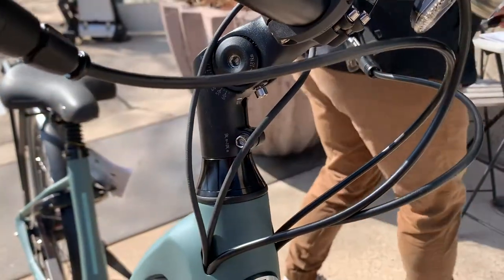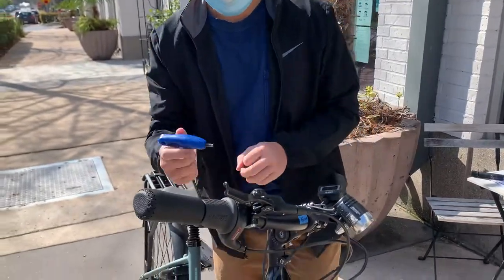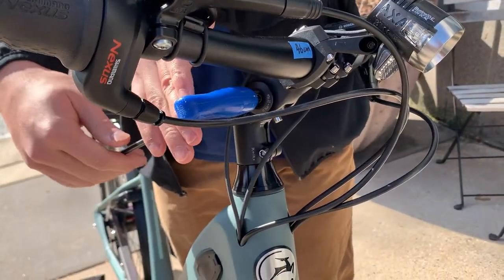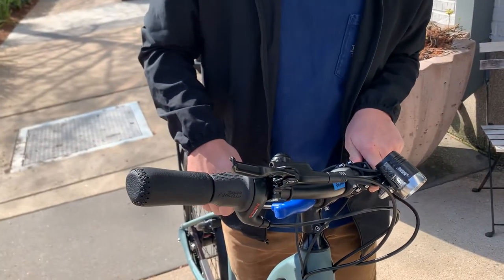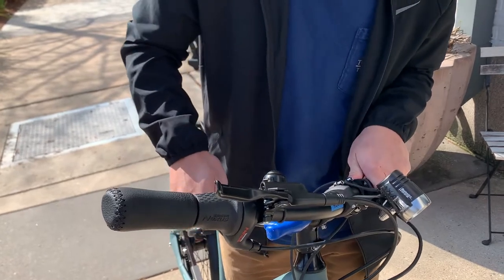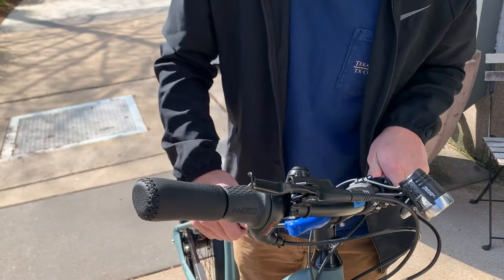If you don't have a torque wrench, you can just use the five millimeter that we were using earlier. Stick it in, make sure it's nice and snug. Then you can pull up or push down with your hand at the end of the arm here, and that's to be about 15 Newton meters. As you see here, I can't really move it much anymore, so we're at 15.